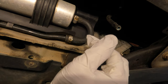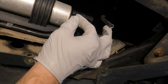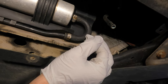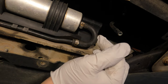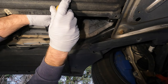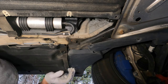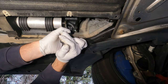This is the line we're going to be disconnecting first, and it has two clamps on it. I've done this job a couple of times already, so I have an aftermarket clamp. If you're doing this for the first time, you'll have the original style clamp which you'll have to destroy and get this kind of reusable clamp for the future. First, you need to remove the clamp and drain the fuel from the line. You may have to use some wire tools to get the hose a little bit loose because it might get stuck.